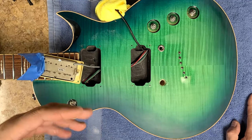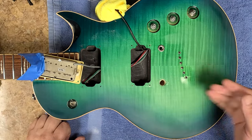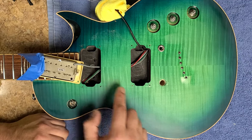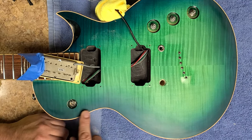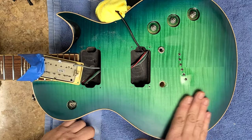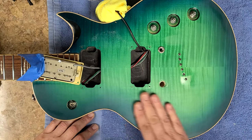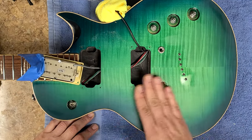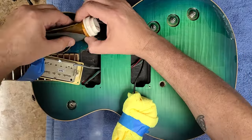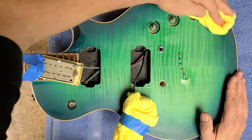I'm using the air gun to blow off and dry the finish to get rid of all the moisture — it helps it evaporate faster and I can see any shiny spots or low spots. I noticed there's a low spot, a shiny spot right over here and a little bit on this side that I need to knock down. But all in all everything else seems to be gone. The remaining spots will be taken care of with the 2000 grit sandpaper — they're not really deep low spots. The 1500 grit is pretty much done.